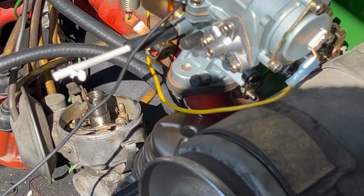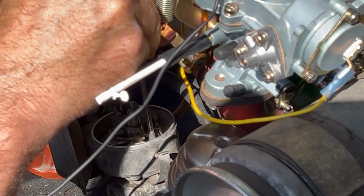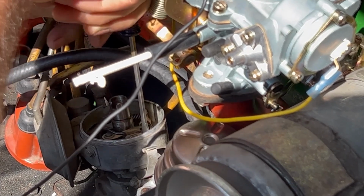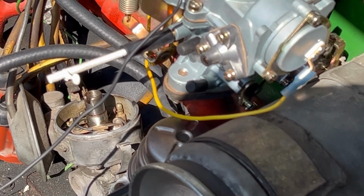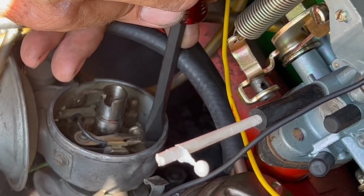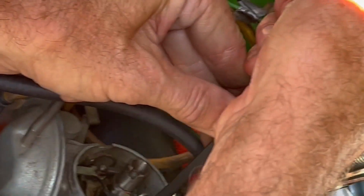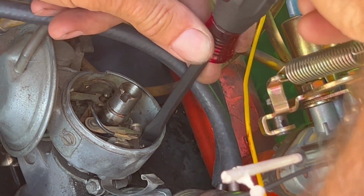Oh, I guess it would prematurely kill your coil though if you're wasting that energy, like turning it into heat, basically. Maybe you basically have to loosen this up. I need a bigger screwdriver. I didn't bring one. Oh, okay. So you just loosen this. Uh-huh. And then there's a little notch. It's so Volkswagen. And you can tweak it a little bit by moving that. Okay. Open and close. So I'm just going to tweak that a little bit. And then wedge this in there.